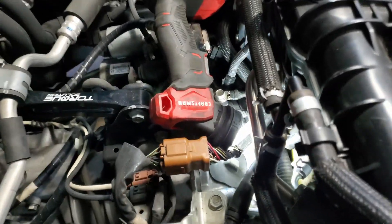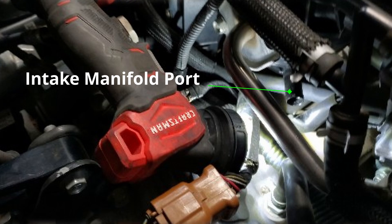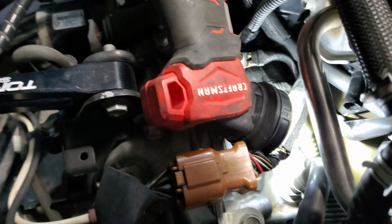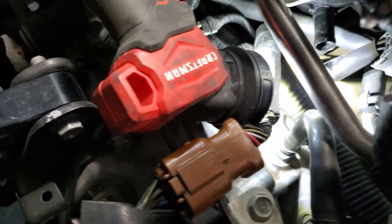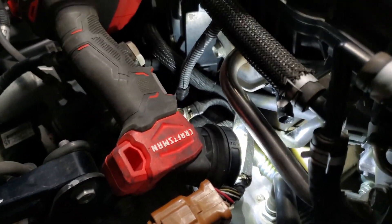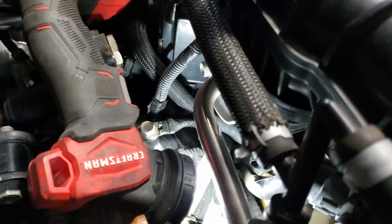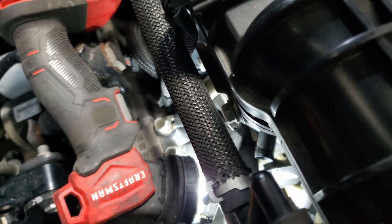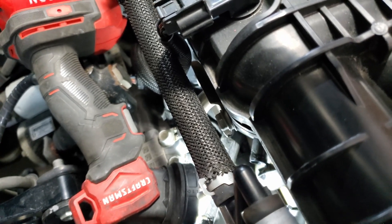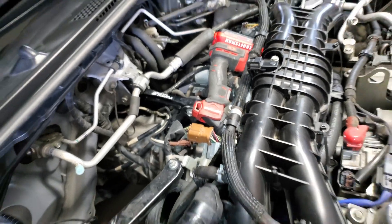Alright, I think I found it — the issue. So if you see that hose, there's a barb there coming off the intake manifold — that shouldn't be open. I plugged that when I installed my air oil separator. If you see the PCV valve down there — so hard to move the camera around — I capped that. But because I have a little more boost going in here, over time that little plug weakened. So I'm going to make a new one and try to look for an actual clamp — I probably used a zip tie. Let me make a little plug piece for that, I'll show you what that ended up looking like, then put this thing back together and do a little summary of what I went through.